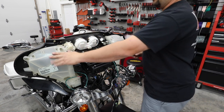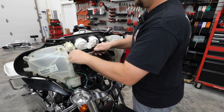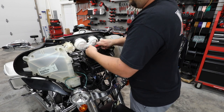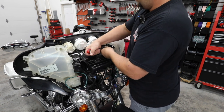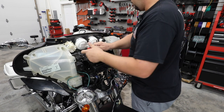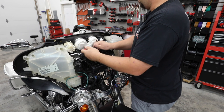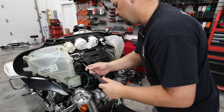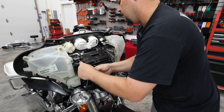All right, so the outer screws that go into this pod are actually an Allen head, but normally your Torx will fit them, and as long as somebody's not messed them up previously and cross-threaded them, you can take them out with hand tools pretty easily. Remove those four. Nice, so all four of those were in good shape, came right out. So after those are done, we're just gonna pull this plate out. Actually, one more step. We got one little screw that goes from our storage pocket to here.